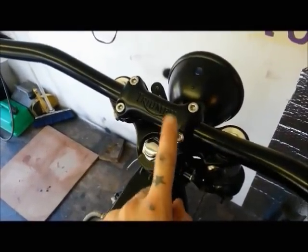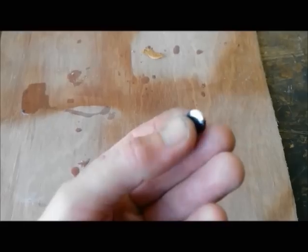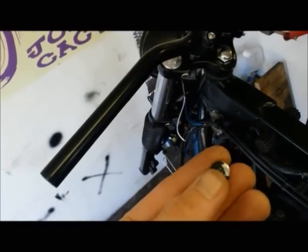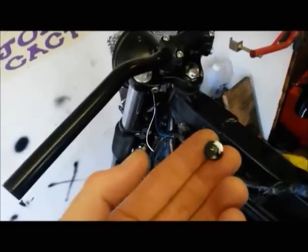What I'm going to do now is the buttons that go on the Allen bolts, they're down here, and it's just the usual thing, those chrome plastic ones that have over the years just worn out. It's all flaked and pitted, and obviously that would look horrendous popping those on. So a quick and easy trick is I'm going to get a little bit of Autosol on a cloth, rub those round, and that'll bring them to black, and we can pop them on, and that'll black out everything, which I think will look pretty cool. So let's get the Autosol.